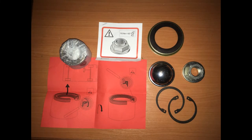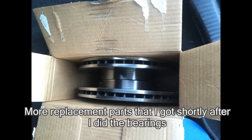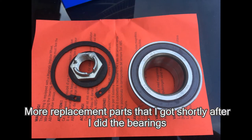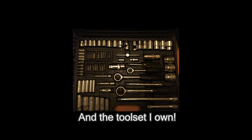I'm saying this again because it's important: the bearings have a special direction they should go in, you can't just put them in any way you want. Also don't forget to put on the ABS rings, otherwise your ABS won't work. After everything is on correctly, do a test drive of a few hundred kilometers or miles, then remove the dust cap and retighten the axle nut.